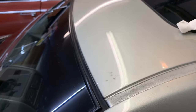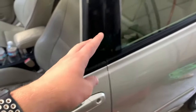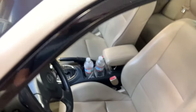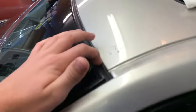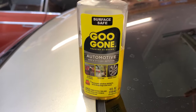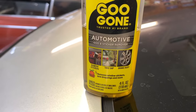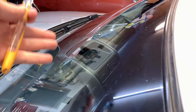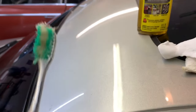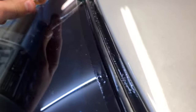It really shouldn't take all that long — I did probably all of the weather stripping in maybe 45 minutes total and it was a massive improvement. I'll show you how to do that around the window here. You're going to get your Goo Gone — this is the automotive version, it works on pretty much any surface. I actually used it to get rid of the sticky dash issue on my 2002 IS300. You're going to get some on a toothbrush and rub it on the weather stripping.